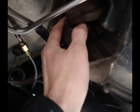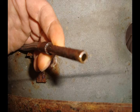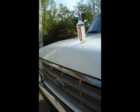Next, climb underneath the front tire, look up at the transmission, and you'll see the slave cylinder. Use the pipe cutter and trim off the line right close to the braided section. And then go and have something to drink, because you got a whole pile of work ahead.